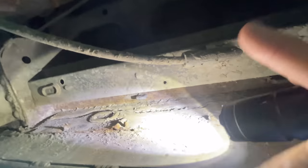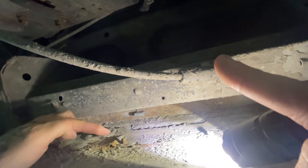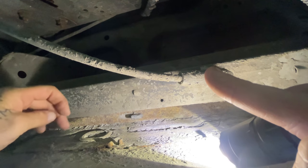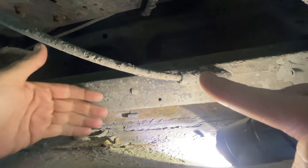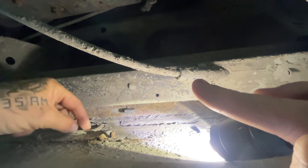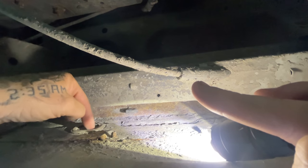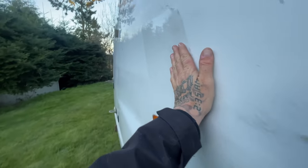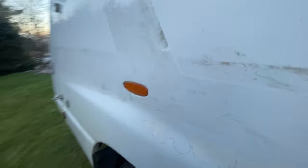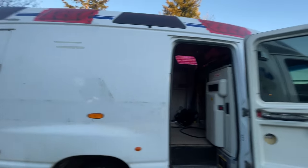So if you guys are wondering, if you look underneath your vehicles, you'll see these little grommets right there. Pop those things out and clean out what's inside of here. Because if muck, dirt, or water gets in here, pop this out and you just let it drain from that point. Usually if you see rust somewhere, you'll find inside of there is going to be packed full. On the body here, you got all the glue residue and stuff from all the stickers that were on there from when it was once an ambulance.